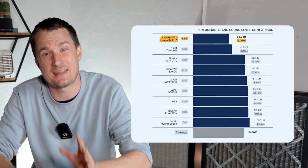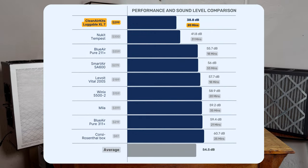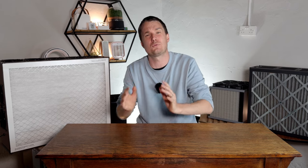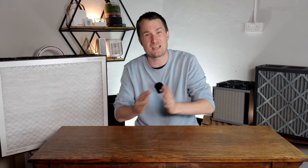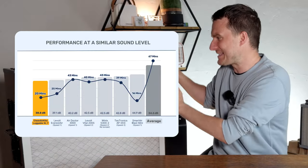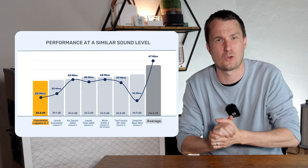Things get interesting when we compare this device to HEPA retail units with similar performance and look at how much sound they make. The first PC fan kit we tested was the Nukit Tempest — really quiet at 41.8 decibels — but the Luggable XL with its seven Sickle Flow 120 fans was even quieter. Most other HEPA retail devices were between 50 and 60 decibels to achieve that level of performance. This is one reason we suggest buying the largest HEPA air purifiers you can so you can run them at lower fan speeds but still get decent air cleaning performance — and even the Levoit Everest Air at speed 1 still took 5 minutes extra to clean our test room of PM1.